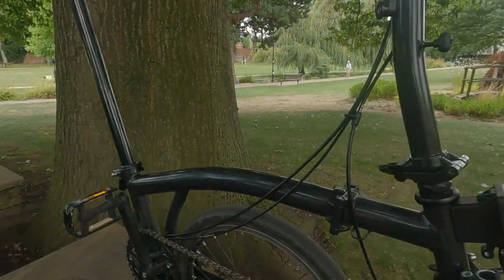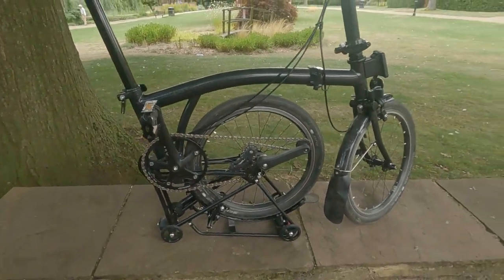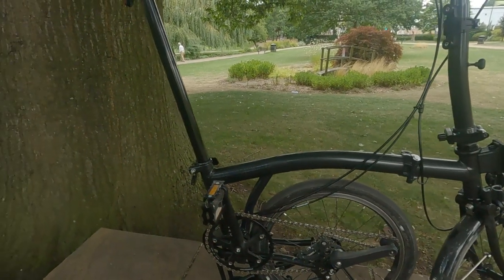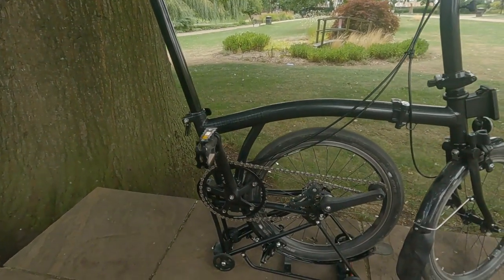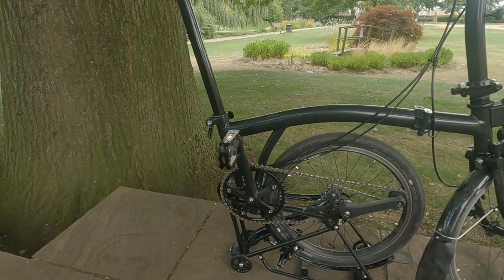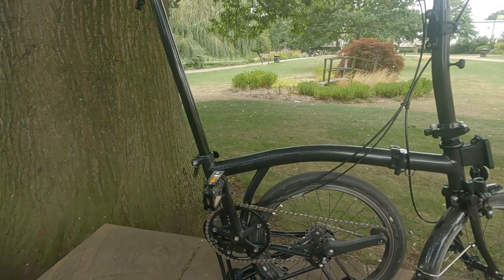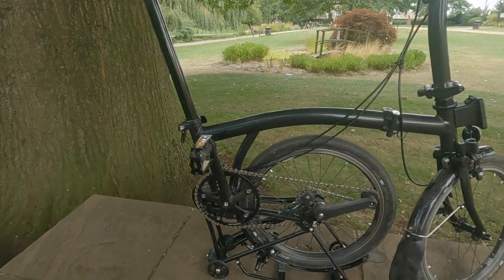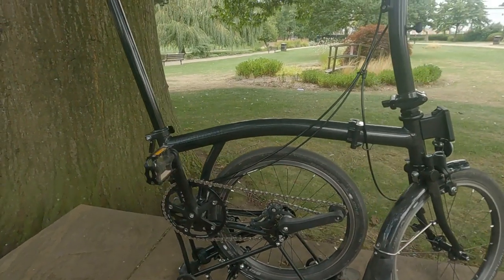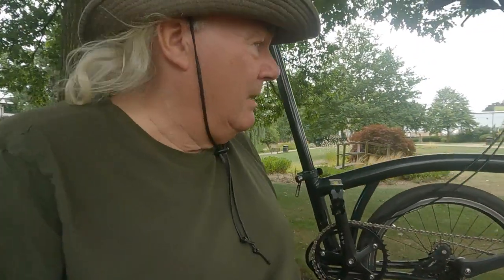Firstly, the inner tubes — the rear inner tube. I've had to blow the tire up every other day since I've had the bike. I got fed up with it, so I took the tube out and put a Schwalbe tube in — no issues now. I blew the original inner tube right up and it had a little pinhole, looks like a manufacturing fault. I also had to reseat the rim tape.